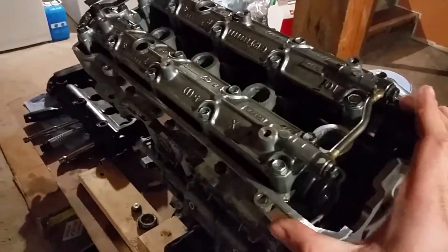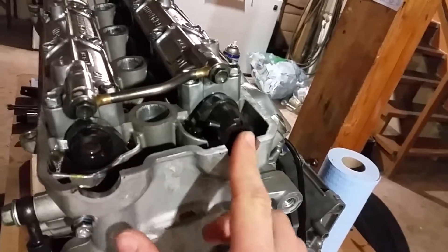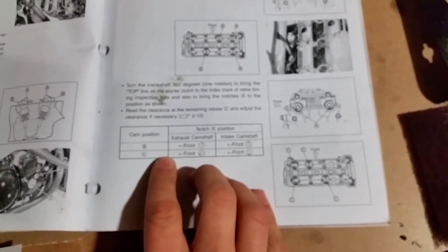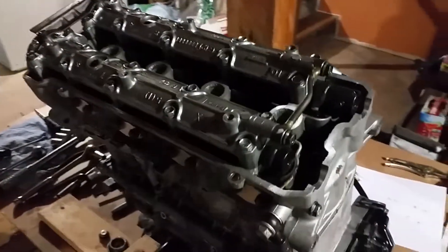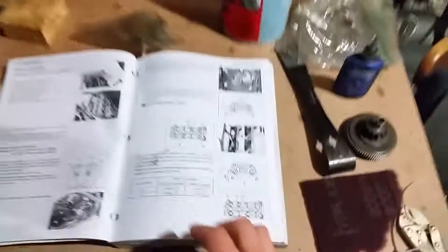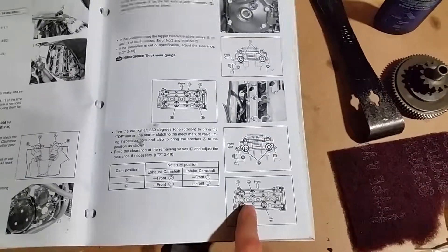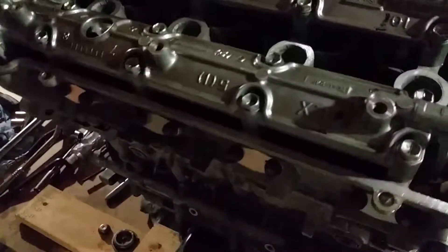You turn it over to a specified spot. With the Suzuki here, it uses the marks and the cams to give you an idea that you're in the right spot. Then it's going to tell you to check certain valves at certain positions — these are both of the positions here, this is the second position and this is the first. The usual way it's going to work is you turn the motor over to one position, check half of the valves, then move it to the next position and check the rest.